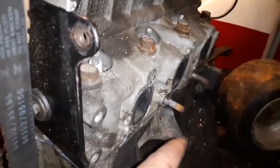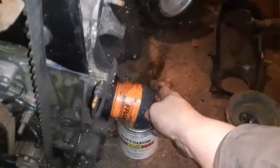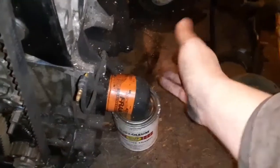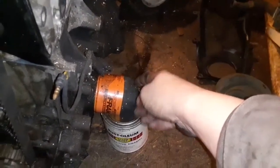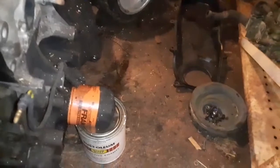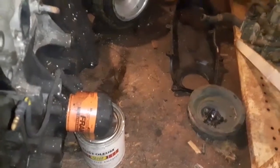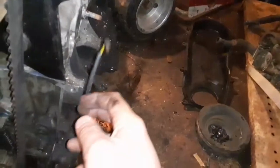When it hit the light pole, the radiator support ran back in here, and you can see here that the oil filter got hit by the manifold. I would normally change that just because it's a Fram, and I've seen these randomly blow a hole through them on about 3 occasions now. They're too thin, and especially when you put a dent in them, it would start leaking right in here somewhere. But it's still good enough for me to let it run 30 minutes on it, and then drain the oil and change the filter. I would have to do that either way, and at least not changing it up front would not be wasting a new filter.